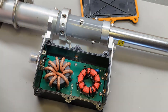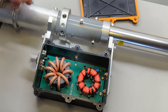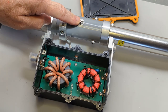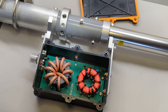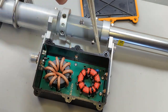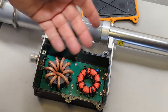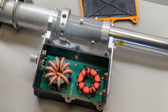Once I did get everything into place and everything lined up, the spacing here was perfect so that the matchbox could sit where it needs to be, but these holes didn't line up perfectly. They were close, but they weren't close enough to get the through bolts through. So if you don't have this in your inventory, you need to buy one - this is a reamer. A couple of shots with the reamer, and everything aligned and went in, and it was all smooth and groovy. Unnecessary aggravation, but there you have it for $300.